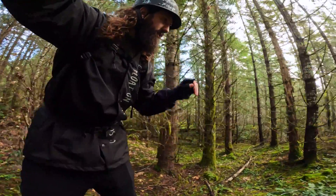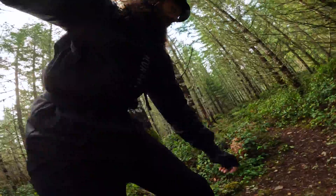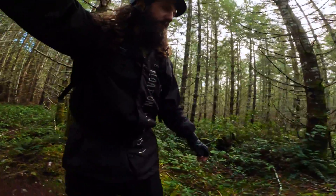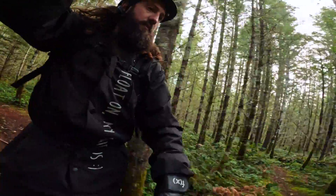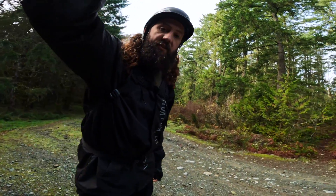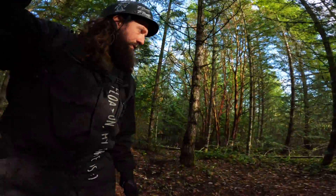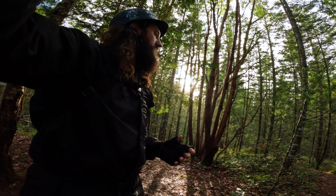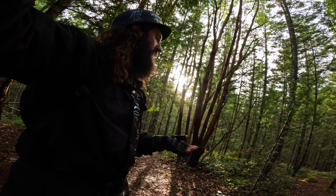Dialed it down a quarter of a degree from the nose — I think it was riding a little nose high and that might be why. As you dial that down, you gotta play with your ATR — it's a fine balance between what you want level to be and where you want your ATR's aggression to be. I had it all dialed in on 64 volt, but yeah, it definitely changes when you upgrade your battery. You can't just grab someone else's tune if your build is a little different — you gotta fine tweak it. Climbing power feels crazy, like if I push any harder I'm just gonna lose traction.